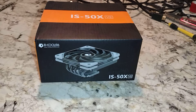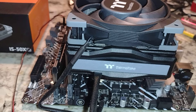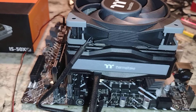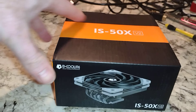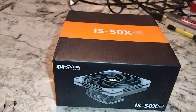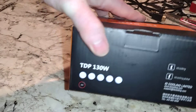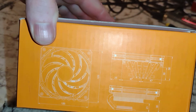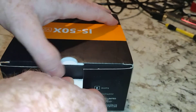Let's bring the Thermaltake down. Of course it's installed. Funny thing is, I didn't have any of this style. I wanted to get the Noctua, but I went and bought this Thermaltake one, and then we bought this ID Cooling one, which will be smaller, I believe. This is the IS-50X V2. It's supposed to be LGA 1700 compatible. TDP is 130 watts. The Thermaltake I believe was 140 watts. This design is not spectacular in comparison to a single tower — probably not going to have as much heat fin on it.